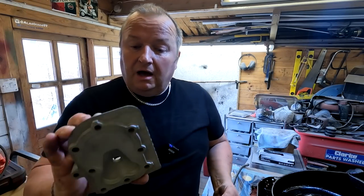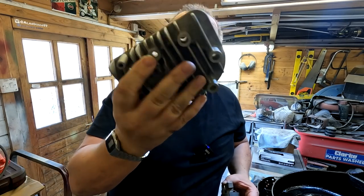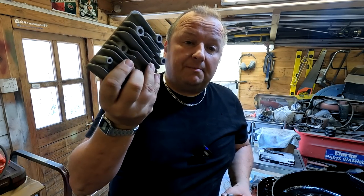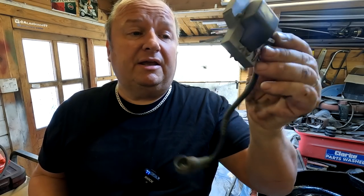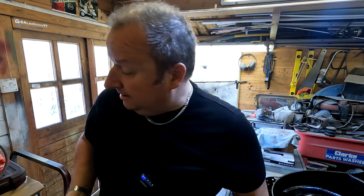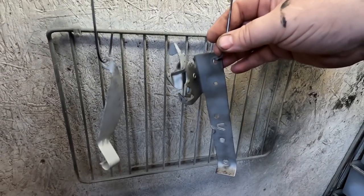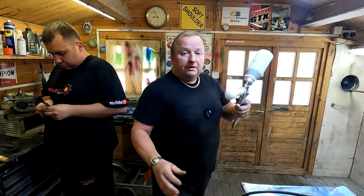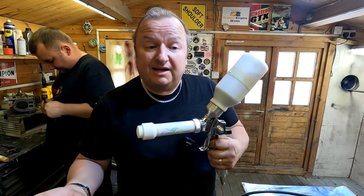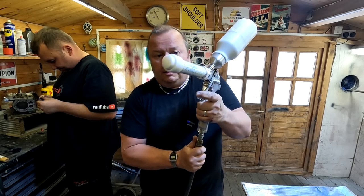Right folks, I've done a bit of cleaning. I've cleaned that cylinder head up now — as you can see, that's been sandblasted, just like a new cylinder head. I'm going to paint this with heat resistant paint. I've cleaned the old coil up — these do suffer from rust — and I'm going to give that a little coat of paint just to protect it. That's all nice and ready to install. I've also prepared these brackets — the engine brackets, some guards, and the speed control bracket that goes on the front. They've all been sandblasted and wiped down with acetone. I'm going to powder coat them with titanium silver.